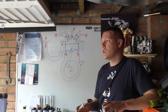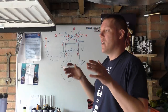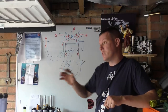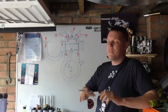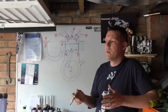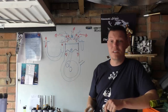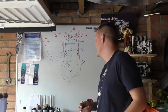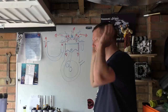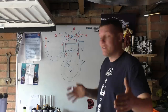The way I like to do it is do a compression test first on, say, two cylinders where the valves are definitely closed — maybe three — and then do a leak-down test on that. The problem with using your crankcase breather is that it can be affected by other pistons if you have multiple pistons with problems. This is where your compression test can tell you which cylinder is knackered, and then you do a leak-down on that one and compare it to the others.